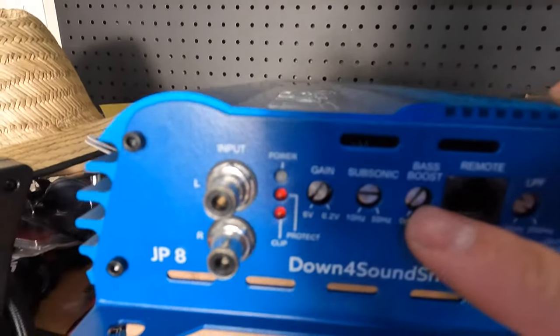The remote is not a bass boost knob — it's a gain knob, which is fantastic. Depending on what type of music you're listening to, you might want more or less gain depending on how strong the sub bass signal is in that particular song. I listen to metal and I also like hip hop, trap, and EDM. Hip hop or EDM music has a lot of bass typically in the master, whereas metal doesn't actually have as much sub bass. So I like to turn the gain up a little bit when I listen to metal to get that nice punchy kick drum coming through my subs. On most amps you can only use bass boost, but I actually want to control the gain. I have bass boost set to zero and my gain set as high as I can for metal without clipping, and with the knob I can turn it down when listening to rap or music with heavier bass lines.